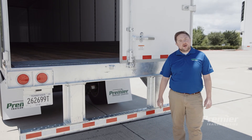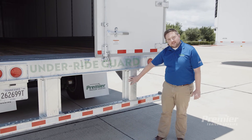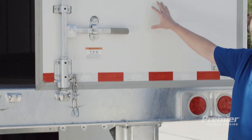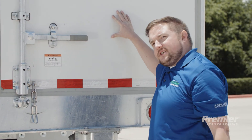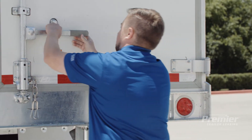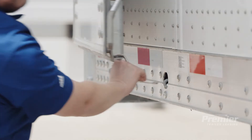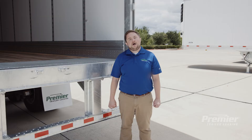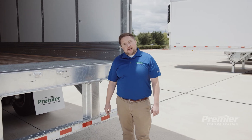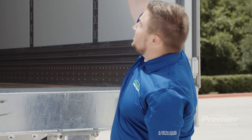Now we're at the rear of the trailer. The first thing you'll notice is the rear underride guard — these were added so that cars do not slide underneath the trailer in an accident situation. This is a swing door trailer; the doors are made of a composite material. When opening the door it's important to check for a watertight seal, as trailers travel through all kinds of different road conditions, and make sure the door is properly secured when open. Other doors commonly used are roll-up doors. The advantage of a roll-up door is that it can be easily opened from a warehouse dock; however, with a roll-up door you lose two to three inches of height at the top, so the best door type will depend on your application.